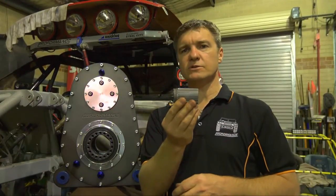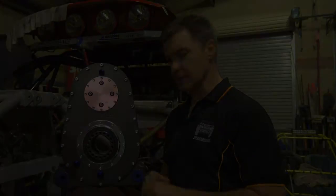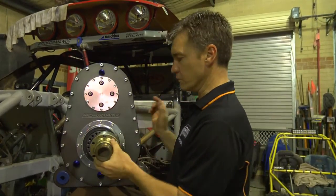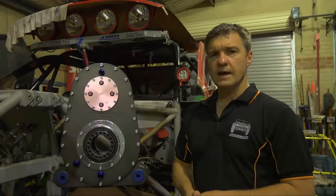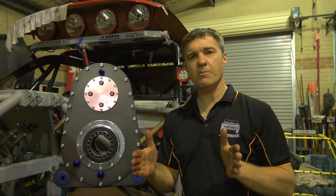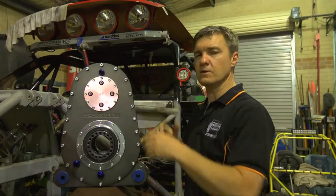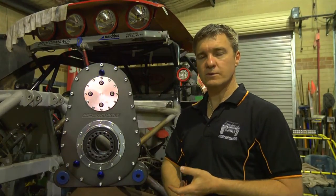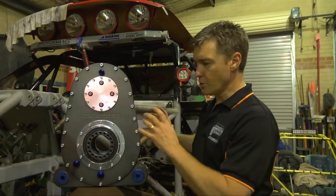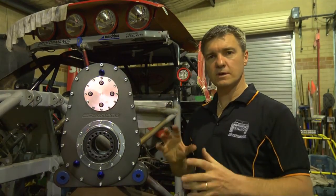It's not uncommon to see the output shafts of a transfer case sheared clean off like this one here. Our quick change transfer case does not have any output shafts to break — the CV joint or universal joint bolts directly to the output hub of the drive gear. Our transfer case is fitted with flex joints mounted either side of the transfer case. The flex joints are very far apart, which prevents the transfer case from rocking left to right and prevents the gearbox and drivetrain rotating under load. The flex joints have been machined into the billet casing from day one. Stopping a drivetrain moving and twisting under load results in a much more reliable drivetrain and reduces a lot of stress on the motor and gearbox casings.